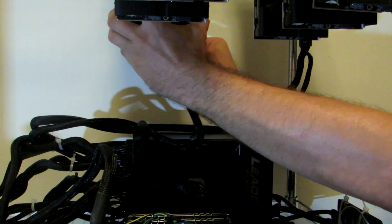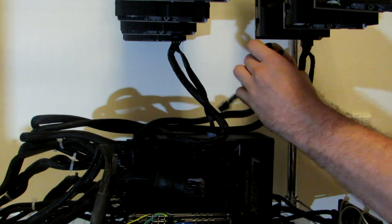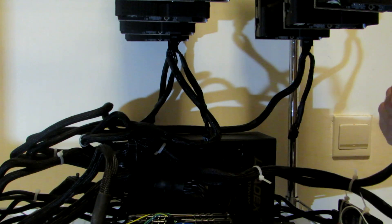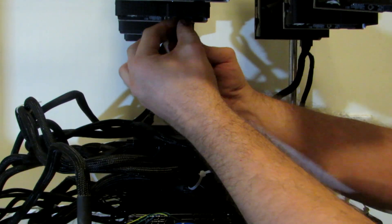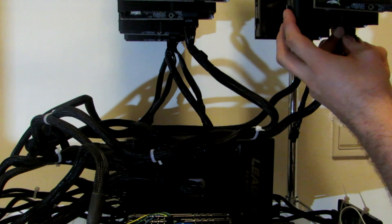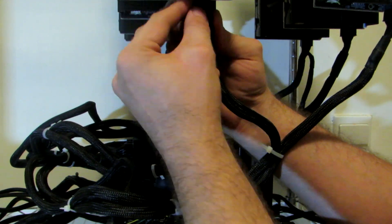Now I'll go ahead and plug in all of the graphics cards, put my 8-pins straight in there. If I could do it all from scratch, I would use 2 PSUs. I'm only using this one because I already had it and I didn't want to have to buy PSUs just for this to get going. I thought I would try this first. I would recommend getting 2 PSUs so that you have extra Molex connectors to connect the PCIe risers better and safer. This is a little bit more dangerous but I thought I would just do it anyway, and I still might switch to 2 PSUs. I might reuse this for another PC. So we're all plugged in — just tidy that up.